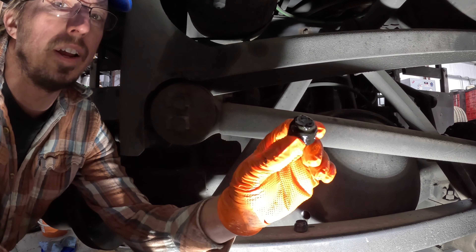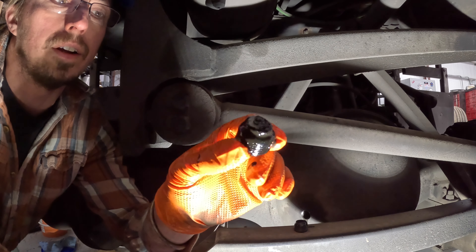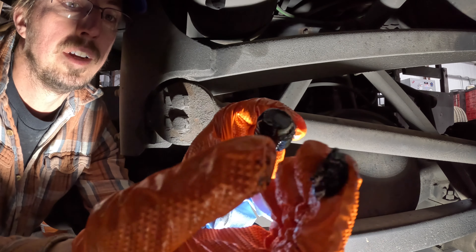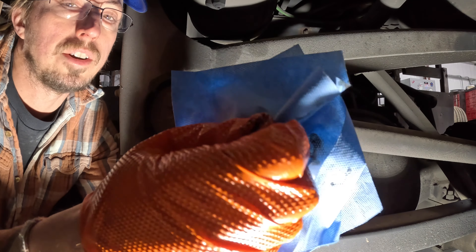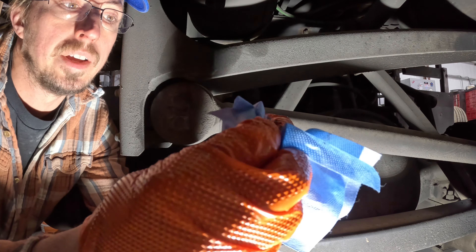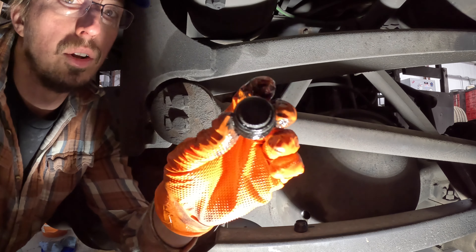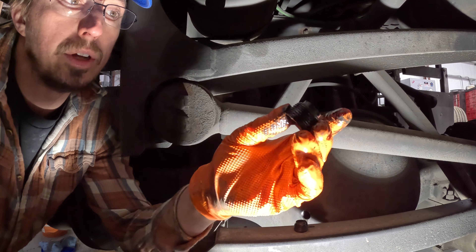I've got the last little drops draining out of the differential, but I wanted to show you the plug. Whenever you drain a differential or any kind of gearbox, especially if there's a magnetic plug, you're going to have some kind of fuzz on it typically — and that's normal. What you see on here is pretty well expected; it just smears off, there's nothing chunky. When you start to get chunks or things that look like recognizable pieces of gear teeth, that's when you want to be concerned. The amount of fuzz on it probably supports that this is very likely original oil, but it was in good shape — there wasn't any water in it. If you have oil that comes out looking like a milkshake, that's really bad.